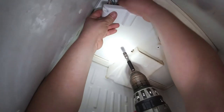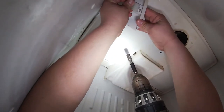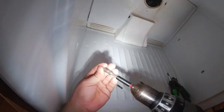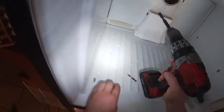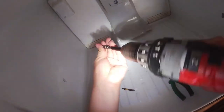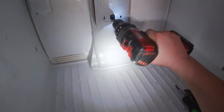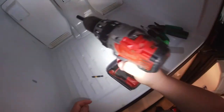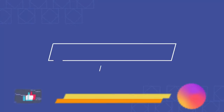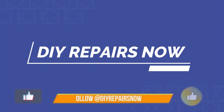If you only have ice on the bottom of the coils, like you saw in this video, just defrost the ice buildup and unclog the drain line, and that should take care of everything. Then put the styrofoam and the evaporator fan motor cover back. Put the tabs where they go and install the one-quarter screw. At this point we're pretty much done. Go ahead and turn it on at the recommended setting. Thanks for watching — don't forget to subscribe.